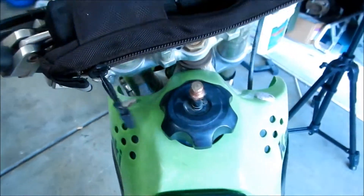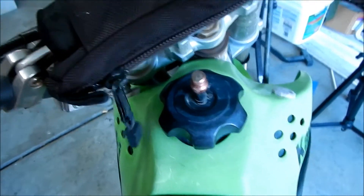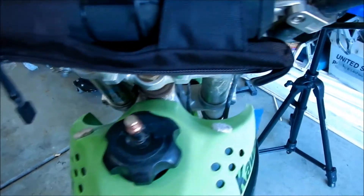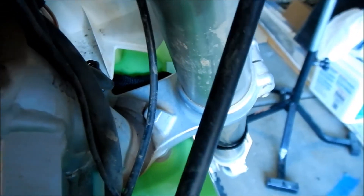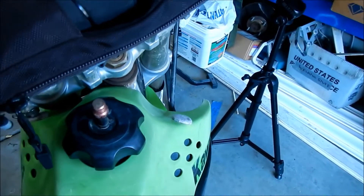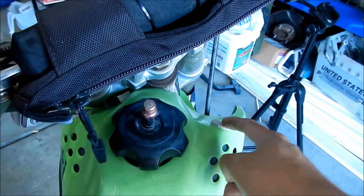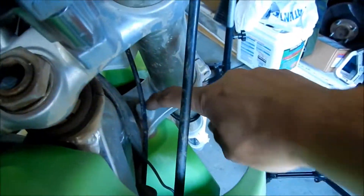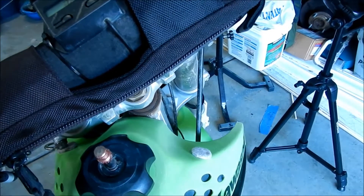So, this bike has a problem since it has a KX front end — it doesn't stop before it hits the tank. It actually hits the tank; the tank is the stop. Normally on a bike, what limits the travel of the handlebars is this tab right there. As you can see, it doesn't touch all the way. It's been like this for a long time. It looks kind of ugly because it's hitting the tank all the time and screwing the tank up, but I haven't had any major problems with it. As you can see, it's fully touching the tank right now and there's still a gap there. That is the problem with having the KX front end — it doesn't stop soon enough.